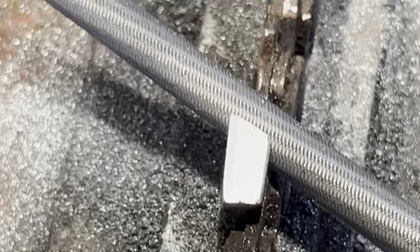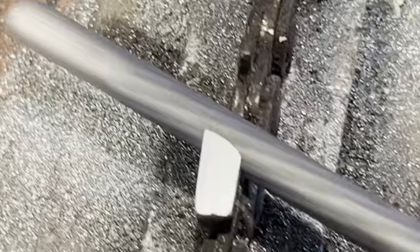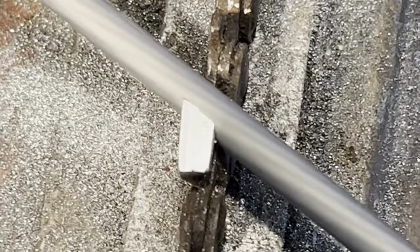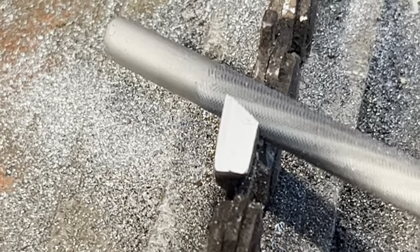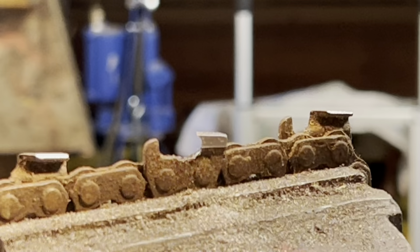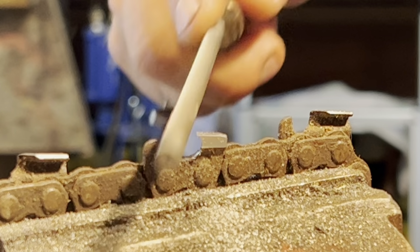Your edge retention issue comes when you get too far under and create this huge gullet. If you don't get this thing straight, see it coming up straight now? And you don't get rid of that burr, you're gonna have edge retention issues. Look at it. It's not there. It's still not there. See it? See the burr? Telling you, friends. Right?